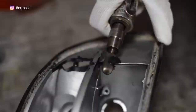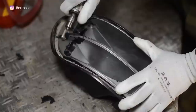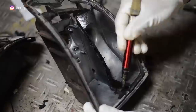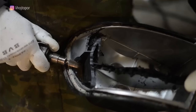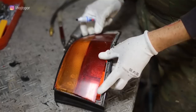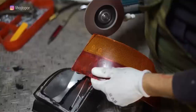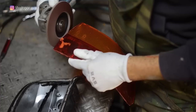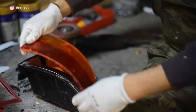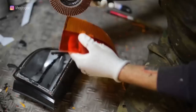In order to place all the necessary components, we remove all the partitions in the lights with the help of a cutter, in order to make a free layout in the future. After we have freed up the maximum space in the lights, we need to make platforms on which the crystals and LEDs will be placed. We took the remnants of the diffuser, since we only needed the frames we had cut out earlier — and this remnant solves all our issues. The plastic is rigid and completely repeats the curved shape of the tail light. We adjust it to the shape and cut axes.